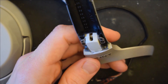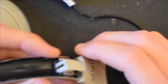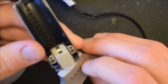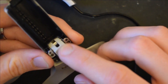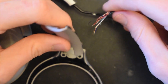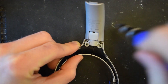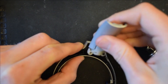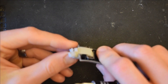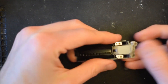There's a comment I want to make before you thread the cable through here. Unfortunately, it's extremely tight and at awkward angles, so I find it's best if you go ahead and take apart this hinge — it makes it a lot easier to get the cable back through than trying to thread every single one back through. Keep the screws somewhere safe; you don't want to lose them.